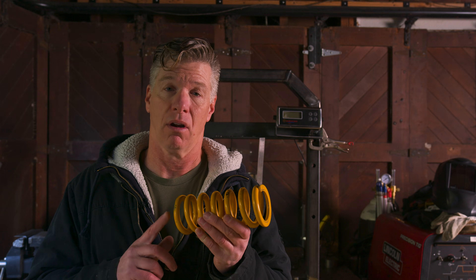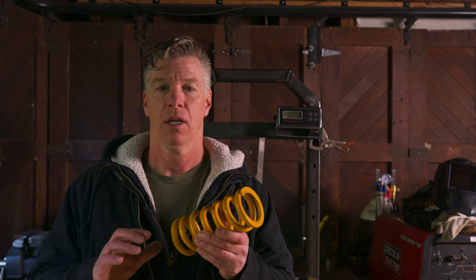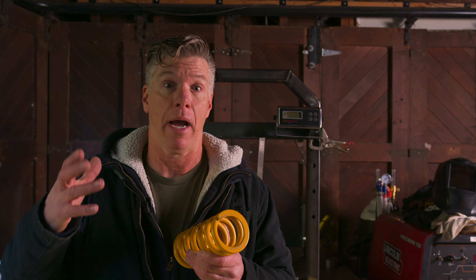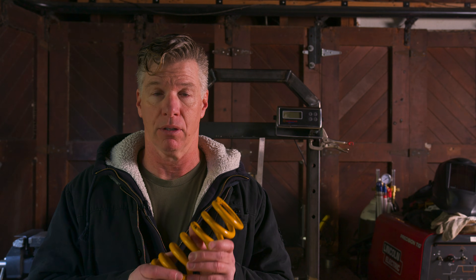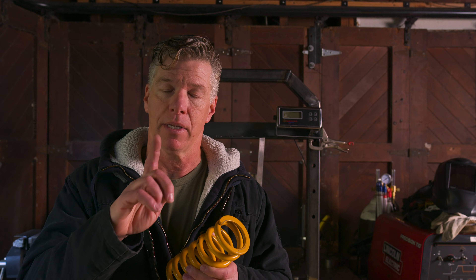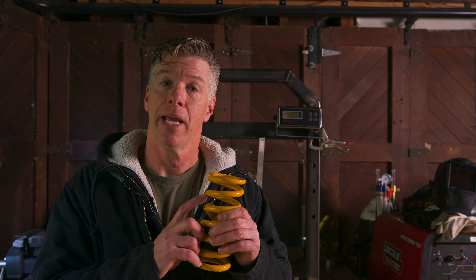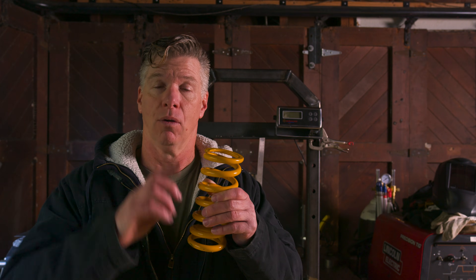Springs are a little bit screwy. It's very difficult to explain all of the elements of springs — between preload, sag, one rider compared to another, what rate should I use. There are so many pieces to this puzzle. I've tried to make this video 12 times and failed every time. So today, instead of doing the whole thing at once, I'm just going to do one element at a time. Today's element is: what the hell is a 110 newtons per millimeter spring? It means it takes 110 newtons to compress this spring one millimeter.